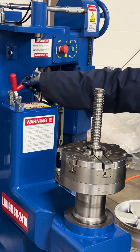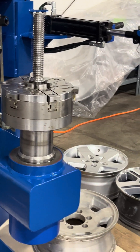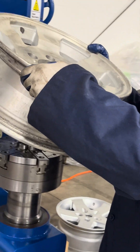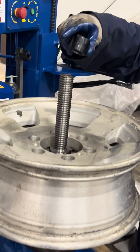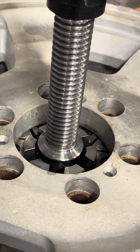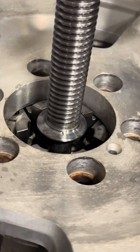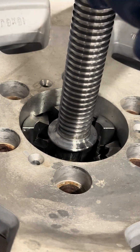When we install a rim, we move this so the six jaws move out until it locks the center hub. For this particular rim we have six lock holes, so I'll bring this rim up. You can see it's a six-lock-hole rim. We put it on the six-jaw chuck first, then use the center handle — engage the first red handle — and move out counter-clockwise. You can see the jaws moving out and it will automatically lock.